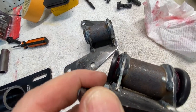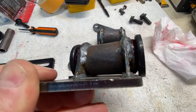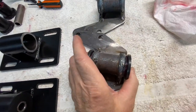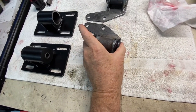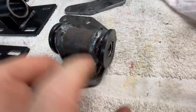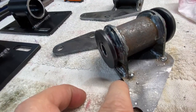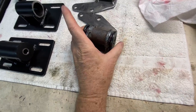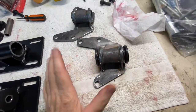When you put your bushings in place, it's definitely a lower quality bushing to begin with. Because the shell is not even with the edge of the base plate, the bushing itself is up against the bottom plate. So when you fasten the other portion of the mount — the tabs over this — it's going to squeeze down and mess up that bushing. Also notice the steel shaft inside doesn't come out to the edge on either side. When you tighten that motor mount, you're pushing against the bushing, and that bushing is up against the outer edge — it's going to tear that bushing up over time.